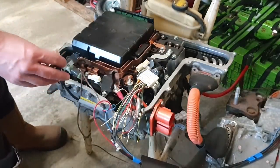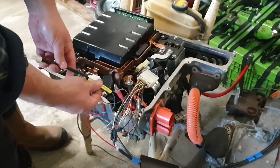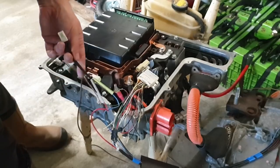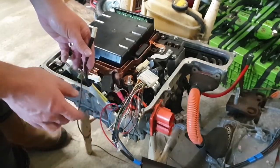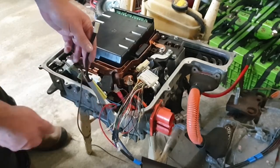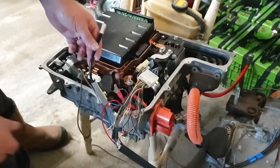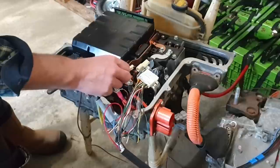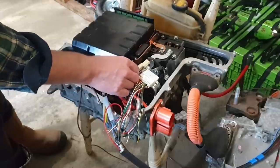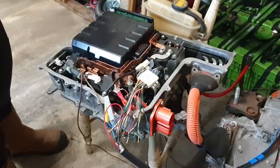There's two wires on this. We've got a red and we've got a blue. Now what I've done here is I've put some heat shrink on here, but until we verify everything is correct, I have not shrunk that, as you can see here. From this we'll go over and tidy up all of that wiring. So now we can go ahead, plug our 12 volt supply into that harness connector there.